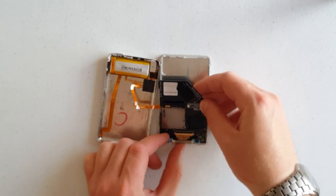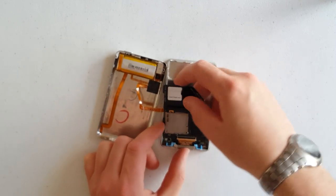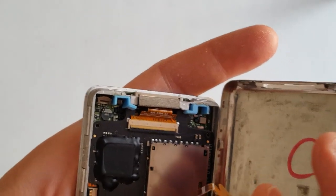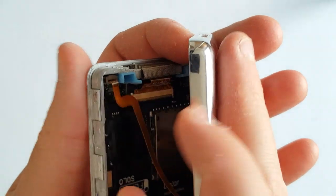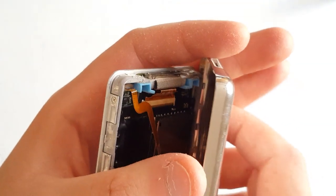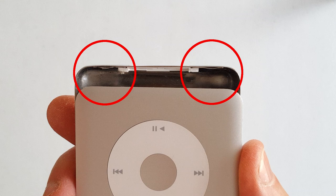Now let's put everything back together. I begin by reseating the ribbon cable plugged into the iFlash module. Be sure to set the end of the ribbon fully into the slot on the iFlash, and then press down on the brown clamp to secure the connection. After that, I use my tweezers to pull up on the brown tab on the battery ribbon cable connector to open it up, then bring the two halves together so the cable can reach, plug it in, and push down on the brown tab to make a secure connection. I also bent back down the two tabs I accidentally bent upright earlier, clamping down on them with the needle-nose pliers until they were almost completely flat.